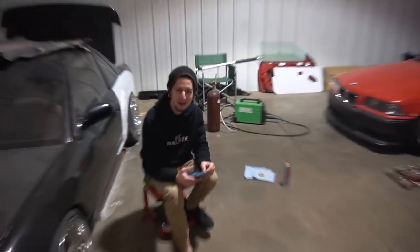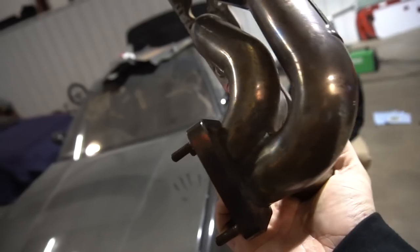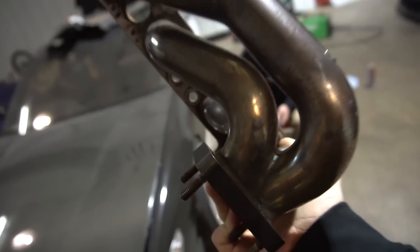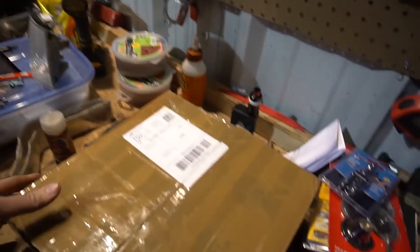What's up Donald? So Donald is trying out a new job — he's in the trial phase of it. He worked 15 long hours, that's why you didn't see him yesterday. His new manifold just showed up and it's really really nice. It's a tubular manifold just like mine, but all the welds are reinforced and it was done really nicely. It makes me want to get it done to mine — any tubular manifold, I don't care how expensive, they always crack. There's a lot of weight and a lot of heat cycles going through it.